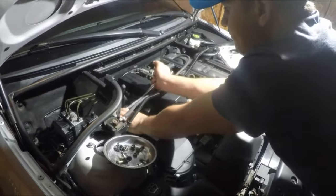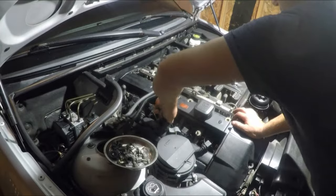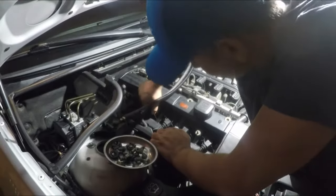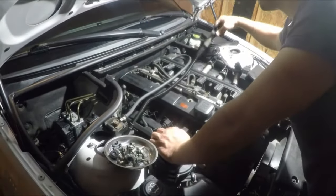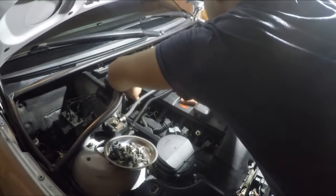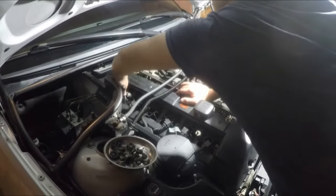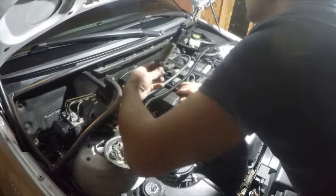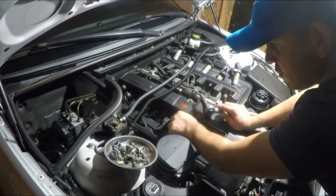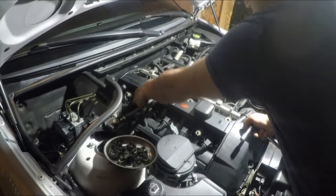Use a small extension of four inches to get into some of the bolts. After that, remove the coils so nothing is in the way and put them aside. Make sure that you don't mix them up, otherwise you might get some misfiring. Also don't forget to remove the 10mm bolt in the middle of the valve cover where the ground is connected.